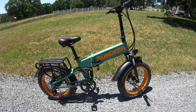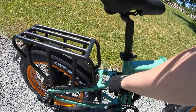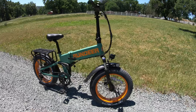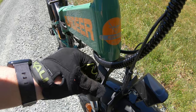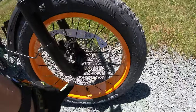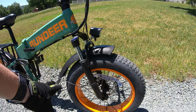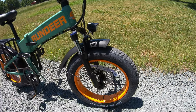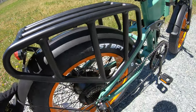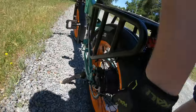This is a pretty typical frame layout. There are some designs with a rear shock down low, some with a rear shock up high, some are hardtails with no full suspension. This is a full suspension folding bike — it has a lockout and open for the front, basic preload adjustment, nothing fancy on the fork. It's not even a quick release — that's a bolted-on front axle. We're running 20 inch by 4 inch fat tires from CST, with plastic fenders front and rear. The rear fender wants to rub occasionally, but that can be fixed by bending the fender stays up a little bit.